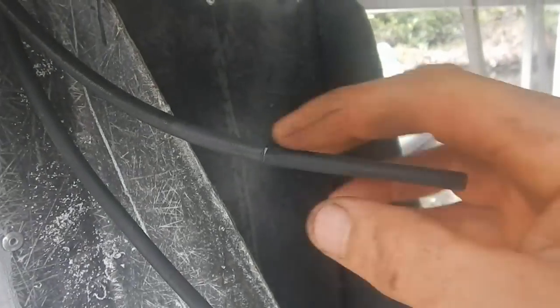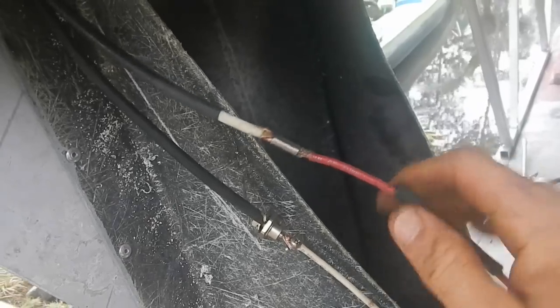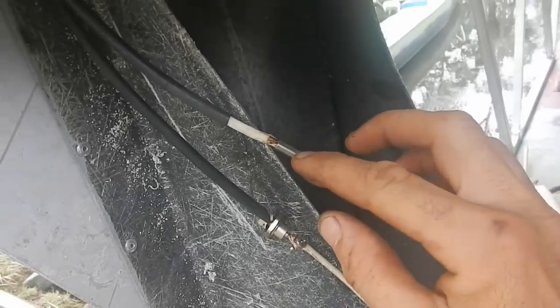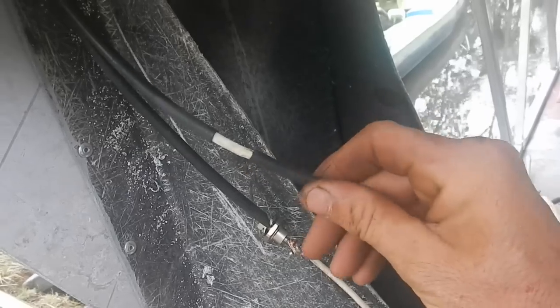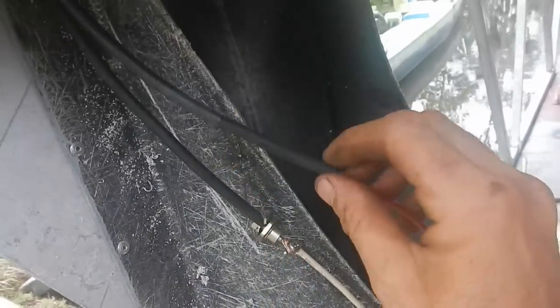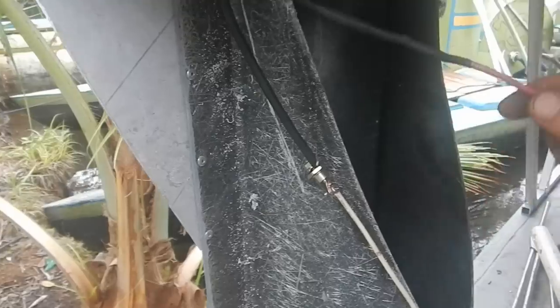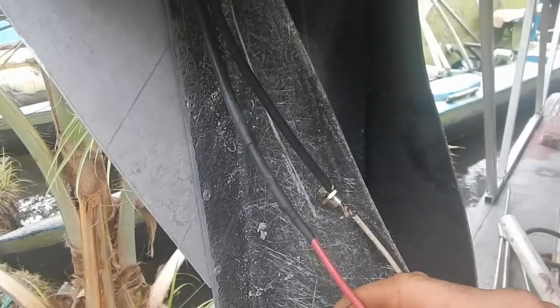Okay, good enough. That's twisted together pretty good. And then I'm going to take a little piece of stainless steel and I'm going to crimp it over the whole thing and just hold it together. Now I've already got my shrink wrap tubing on there — you always got to put that in before. Alright, that is a mighty good connection right there. This is just a little square of stainless steel cut off something. Now I need a lighter for about four and a half seconds — you just heat it up with a little lighter and it shrinks. Now there is a good connection.